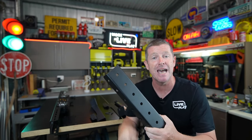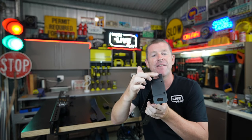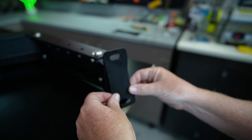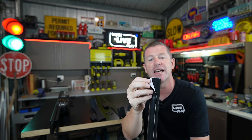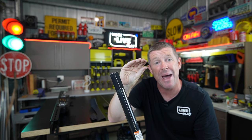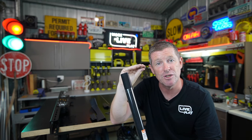If you want to shorten the legs down, you can cut them as well — just remember to round them off, make them nice and tidy, and touch them up with satin black. Now while we're talking about the landing feet that go down onto the roller shutter itself: instead of having bare metal sitting on the aluminium of the roller shutter, I'm going to put a felt underlay piece on as a buffer so it's not scratching up the anodised aluminium finish, or wearing through the black finish. I've got some 1mm thick felt with a sticky back. I didn't want to use 3mm foam because it would compress down over time and start making the whole setup loose.